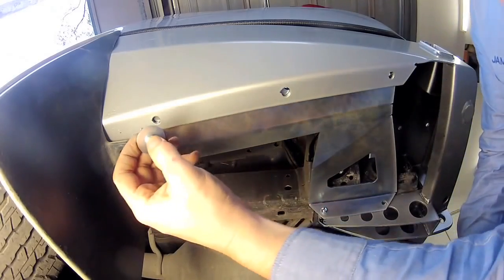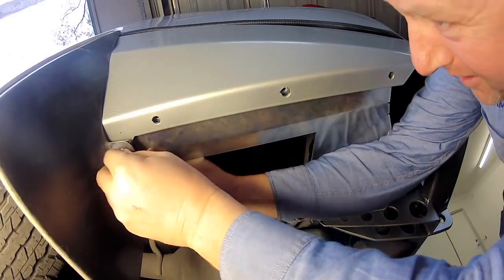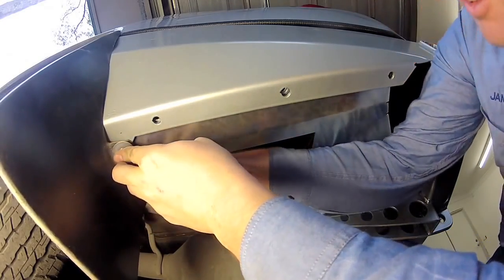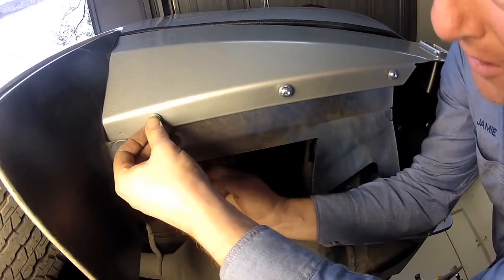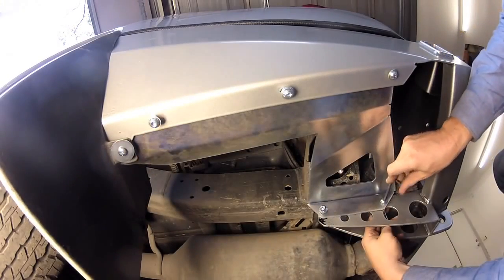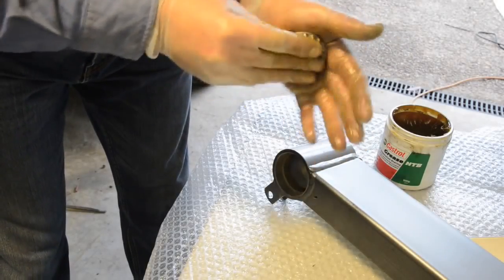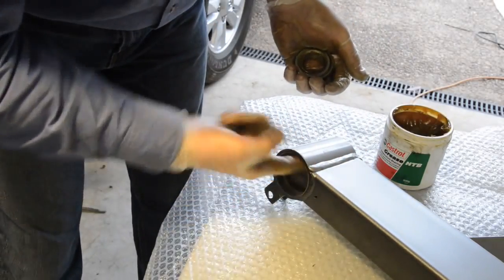Moving under the vehicle, you can then fit the bumper wing supports using the supplied screws to also secure the bottom of the mud flaps, then the button head bolts to secure the supports to the bumper wing, and then back to the chassis mounting brackets on the bar. It's now time to prepare and fit the wheel carriers to the bar.